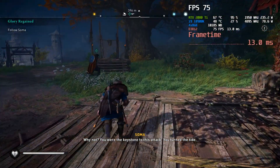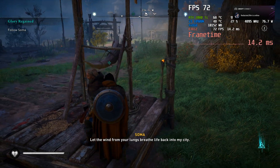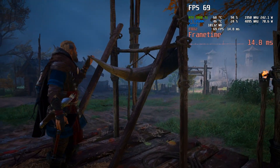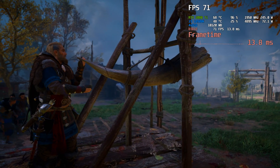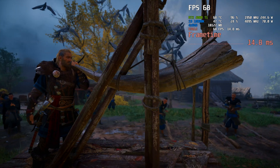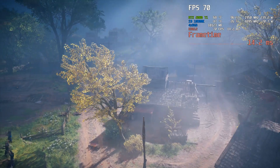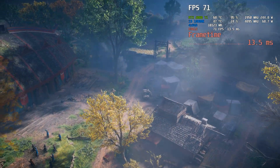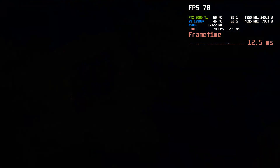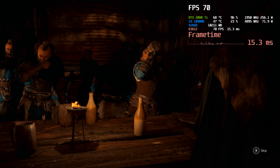And this thing is a beast. I was playing Madden, and with my H60 I would sometimes get 78, 81 degrees and it would drop back down — 81 would be the absolute max. Whereas with my air cooler on the 2700X, the Wraith Prism, it used to spike up to like 87 degrees. So 81, for it to just peak for a split second and drop back down to like 77, I was okay with that on the H60. With the H150i Capellix, this thing was hard locked at like 55 degrees. It blew my mind.